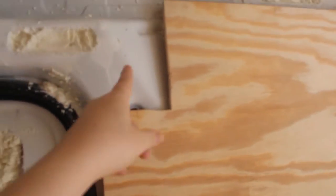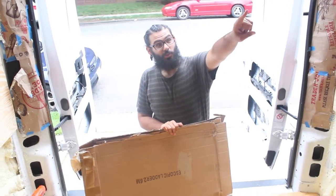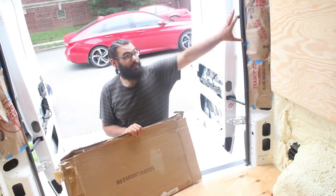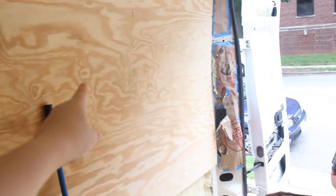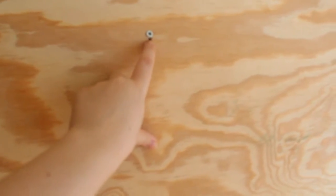The cuts are pretty nice and we didn't use any templates for them — we just matched it up and went boom, cut here, cut here. Now we're going to use templates for the door. The only one that came out weak was our first one. After you do that first cut it gets easy — my suggestion is cut a smaller piece first, start with like a back panel, then go large. Also, the wider the panel the weaker and bouncier it is. Make sure you know where your ribs are because he missed twice.